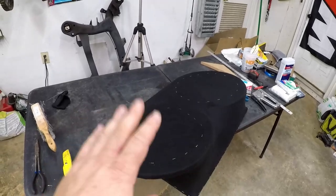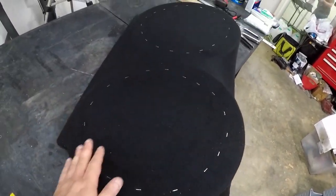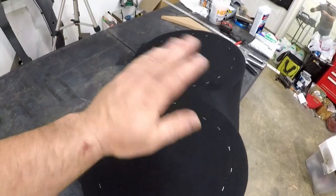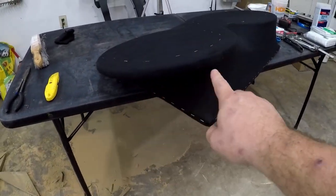The next few steps are where this process differs from a subwoofer enclosure. With a subwoofer enclosure, we would put resin over this, cut the middles out, bondo, paint, and put subwoofers in the holes. But we don't want all that weight hanging off the back of our radiator. So I'm going to put resin over it, smooth it out, cover it in masking tape or saran wrap, then start laying fiberglass on top - two layers: one of fiberglass mat and one of fiberglass cloth. Then I'll pop it off this contraption. Looking at it, we're not going to be able to pop it off without cutting it because of this ledge right here. I'm going to go ahead and resin this and take it from there.